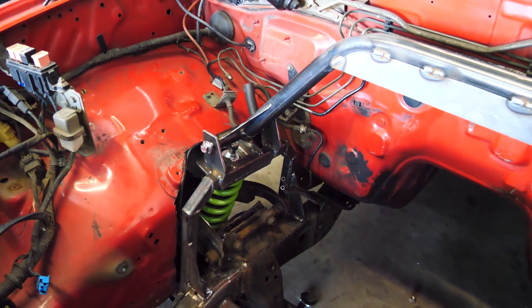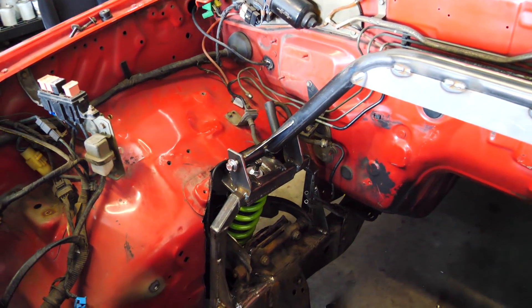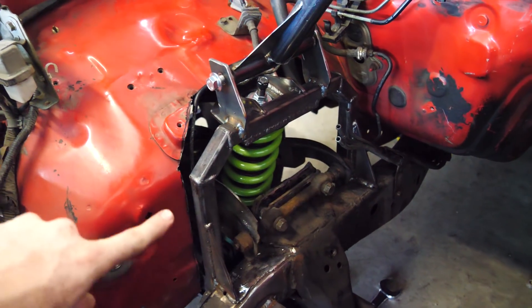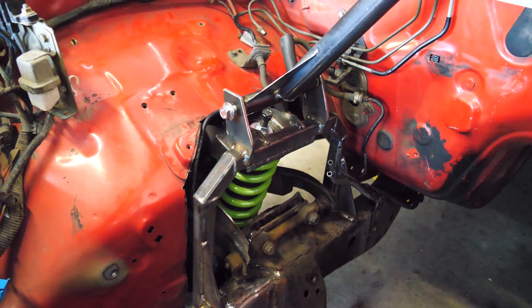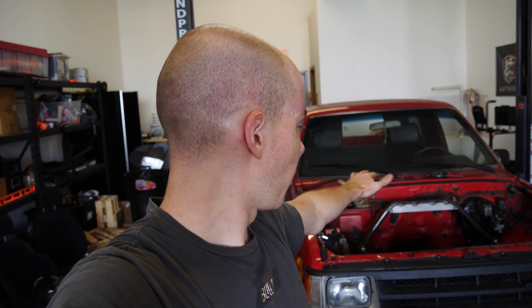Now it is time to reinforce the strut towers themselves. I did a little bit more welding on them, so they're 100% welded up. We're going to add another brace connecting the two uprights, and then a sheet metal plate that connects all of this with gussets in it. Another thing to keep in mind — one reason it looks funky right now is because it's in a really crappy engine bay with rusty old stuff everywhere. When everything is brand new and glossy — remember how good the RX-7 engine bay looked? Imagine that with all this fabrication, all gloss black. It's going to look awesome.